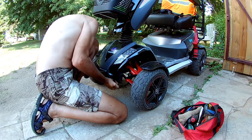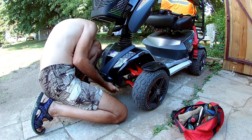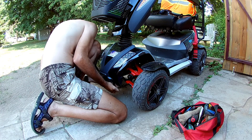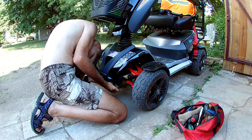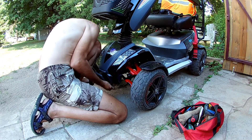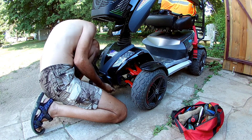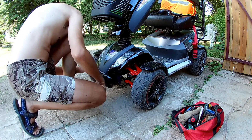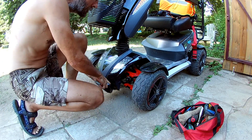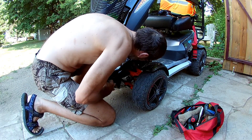So what I've learned is the springs — the suspension itself — can't support the weight of the scooter. The purpose of the bar is to keep the suspension kind of in the middle, not compressed and not decompressed, and also to keep the wheels aligned no matter which position they're in, whether one wheel is up or down. So my idea of putting in a tension spring is now out the window — apparently I can't solve that problem.